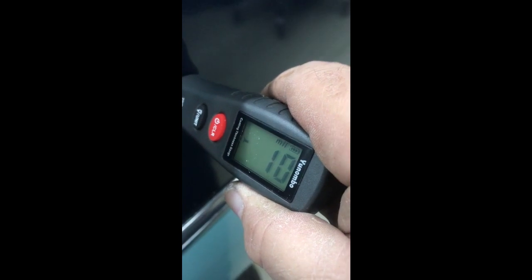Let's go down here a little bit to where I know we have some Bondo and bad rust repair. Let's go way down here to the bottom. Overload — that can't be right. Let's look up here: ten mils. Now let's get down here on the... Overload. 62 mils — Bondo City.